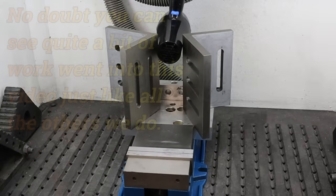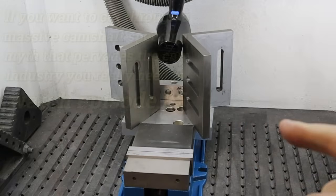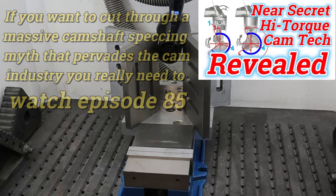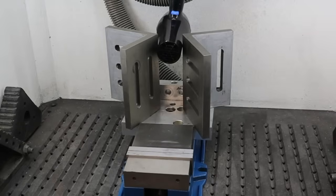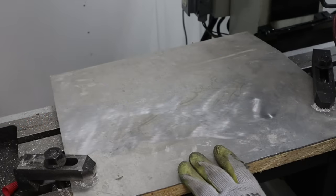Here's the setup for doing this thermal testing — I've put it on my grinding bench. The reason for that is the grinding bench draws air in. So although the hairdryer there has a sufficiently high stream of air to play on the back of a matte black aluminum sheet, the air doesn't come around the front. It hits, spreads out, and goes down. A simple test fixture.